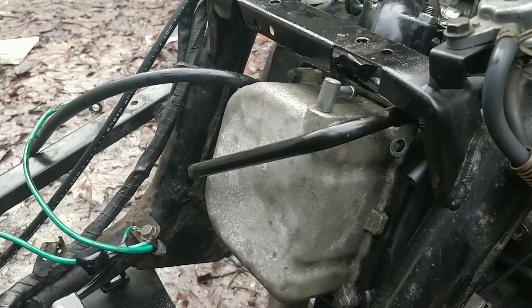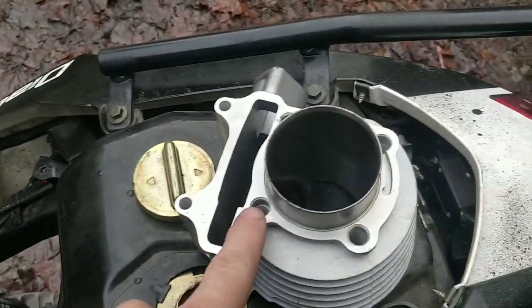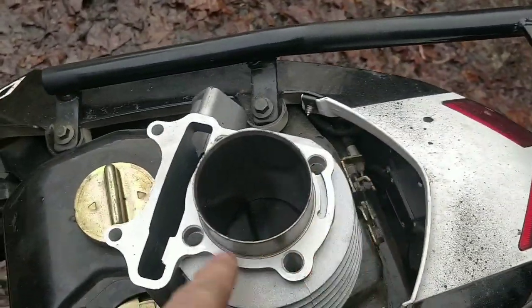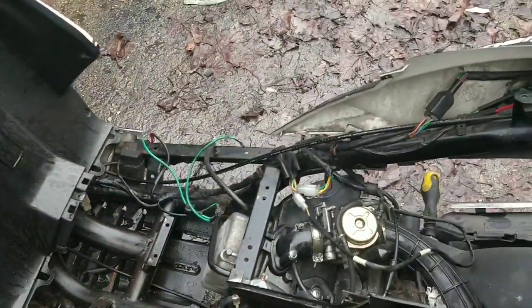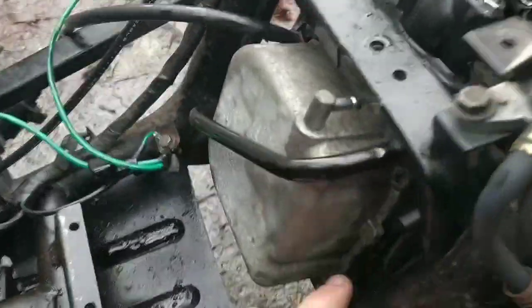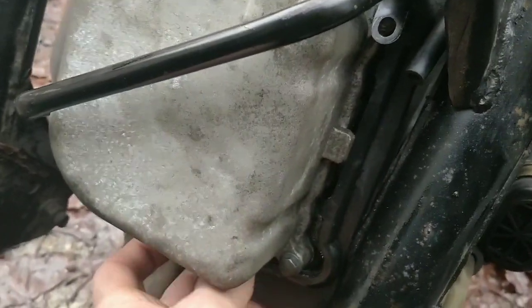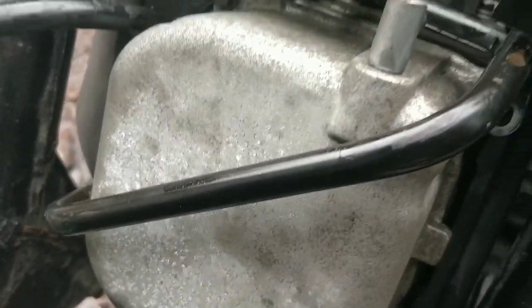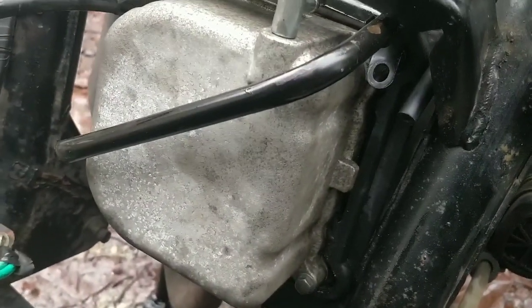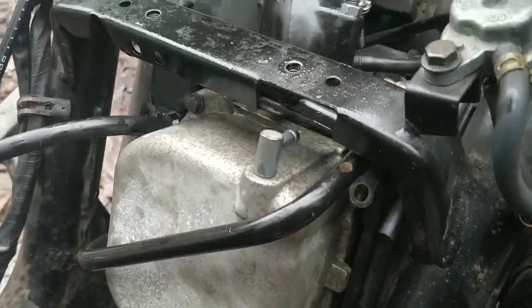I'm still in two minds about the theory. I'm hoping my cylinder has two holes for alignment - even if they have four like this, they're two to fit and align it. My next theory is that I tightened the side bolts down here first, which is what we do on other engines. But I want to do them all in order now and have them all seated properly. So basically I'm breaking the engine back down and pulling everything off.